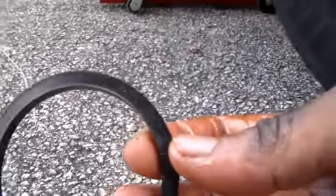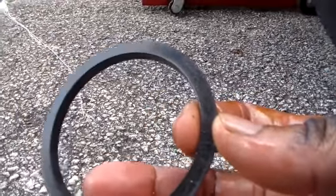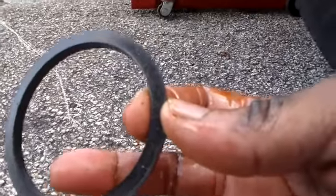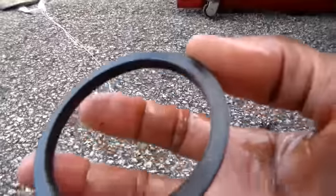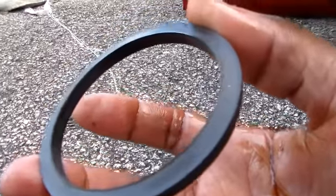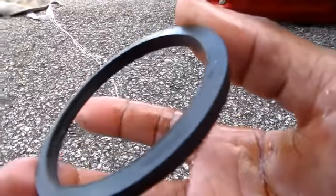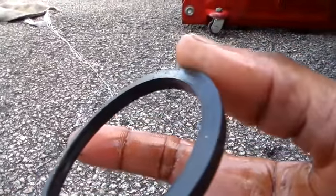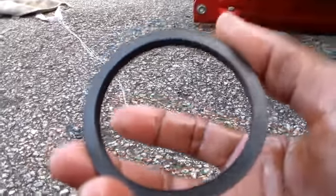Let me show you. There's a gasket that goes to the top of the oil filter. One time I was changing oil and this gasket did not come off. So when I installed the new filter, I got everything tight and put the oil back in — it started leaking. I noticed the old gasket was still stuck there. When I removed the oil filter the gasket stayed on, so when I installed the new one I had two gaskets. Make sure that the gasket comes off with your filter.